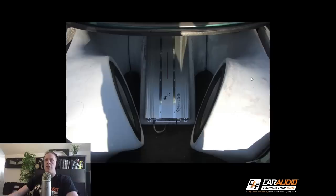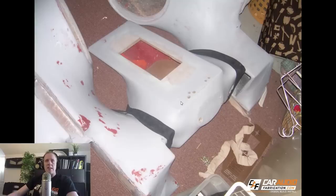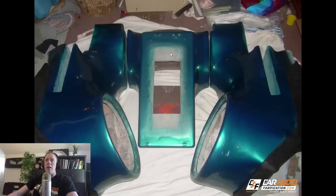We go from that to everything in a light coat of primer. You'll notice I made some fiberglass transition pieces - I protected each of the shapes with painters tape, laid down a layer of fiberglass on top, then cut and trimmed it to size and wrapped it with some suede. I cut several holes for wiring to the different devices - if I were to do that again I'd use a grommet to make it look cleaner, and I'd hide the wiring completely rather than having it exposed. I did add a large cutout underneath where the amplifier was, both for cooling and to reach my hand inside to run all the different wires.